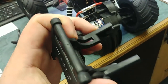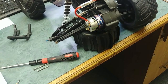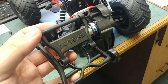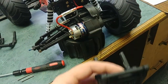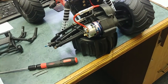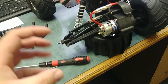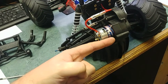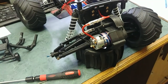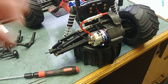This is a four-position wheelie bar, by the way, which is even better. So it slides on and you just screw it back in place — I'm not sure why they give you new screws, but they do. To get to the lower transmission bolts over here, you have to take the wheel off, otherwise you're on an angle trying to get a straight shot. So I had to take the wheels off anyway — and speaking of wheels...